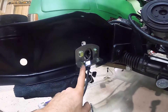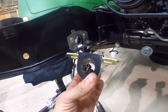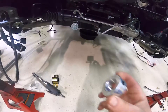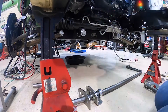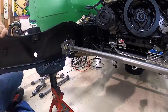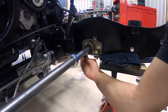Our brackets are installed. All we had to do is use a factory bolt hole on the front side of the rail. We already notched the frame rail and had to drill three holes. This angle piece holds the sway bar bushing mount and gets repurposed with those two bolts holding this bracket in. We have end caps that will hold the sway bar in position and stop it from sliding back and forth — if it slides, you're going to have issues with the sway bar locking up. We still have to put the end joints on either side of the lower control arms, then fit everything, take it apart, paint it, and put it all back in.